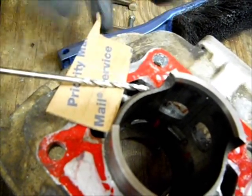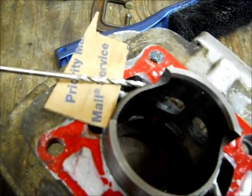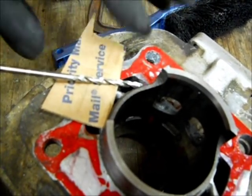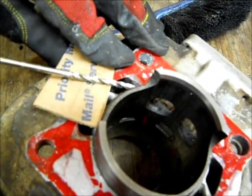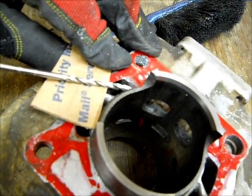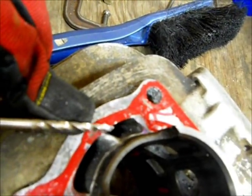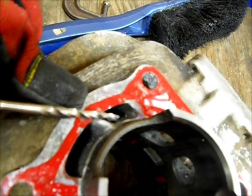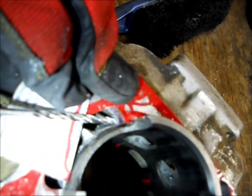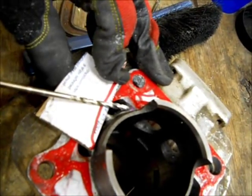You also want to kind of angle it to where you're just right next to your liner there. You don't want to cut into the liner or go too far away from it to start with. So, I'm going to start right about here. And as a rule of thumb, I end up lining this corner right in here straight into that. It just seems to work for me. The geometry of it seems to look pretty good, so that's the way I do it. You guys do your own however you want to.